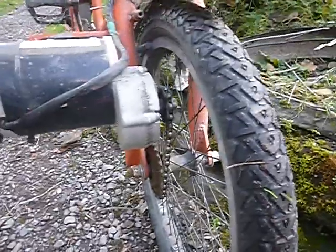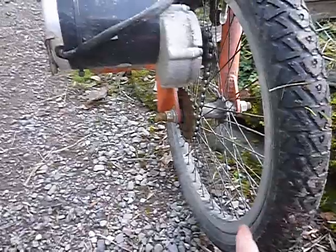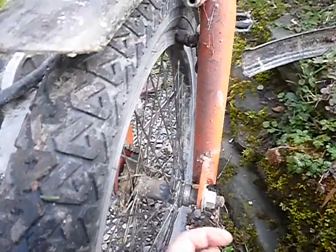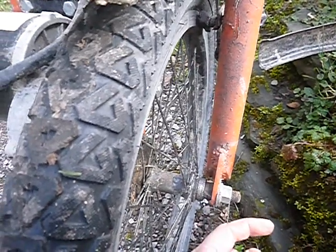This is the main weird part. This is a rear wheel — a BMX wheel mounted in front forks. In order to do that you have to move this dropout here 10mm to the left or right depending which way you're looking at the bike — the right in this case. And then you can fit your rear wheel in the front forks.